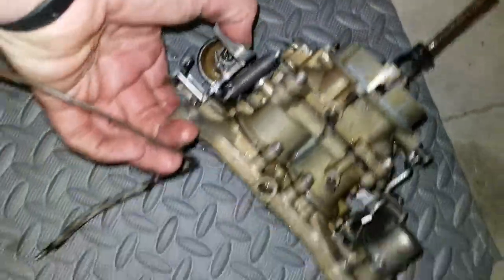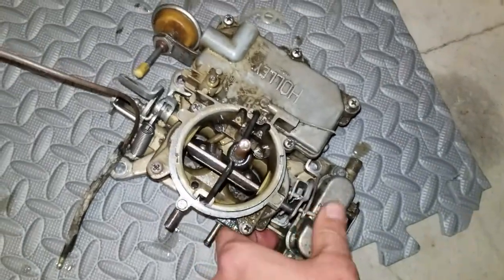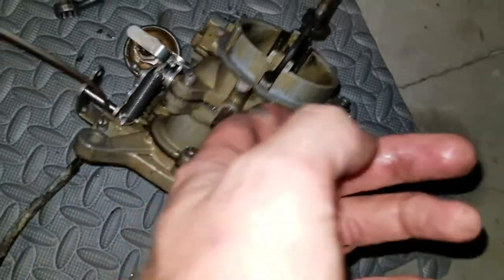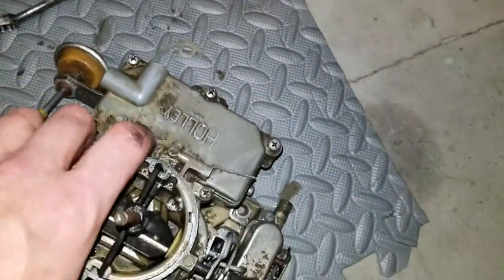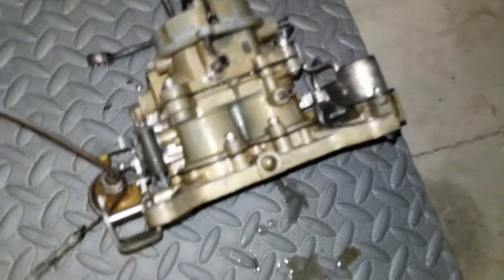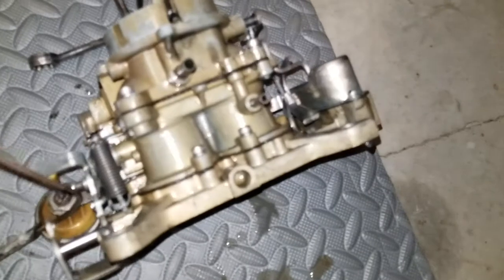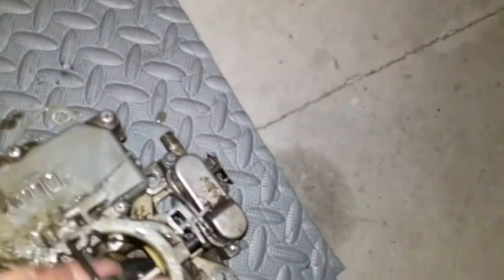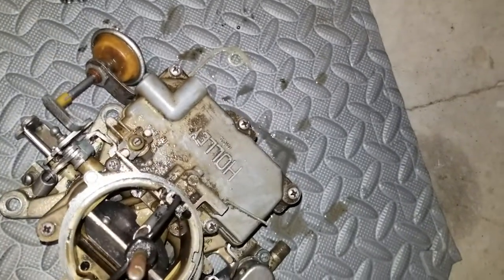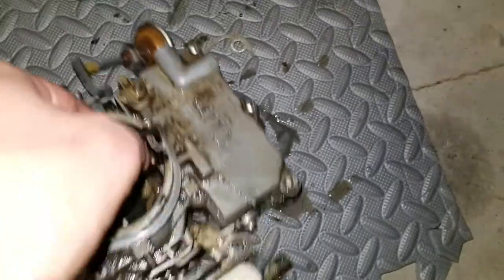Wow — this was sticky before. This wasn't moving freely, so that's cool. Did pretty good on that. We went through this carb once already but it sat out in the tank, so it needs to be gone through again. It looks like EvapoRust did a pretty good job of cleaning it up. Use some brake clean, get it fully cleaned, take it apart, use brake cleaner or carb cleaner, and get it all sorted out. Get the bowl cleaned up along with the float and stuff.